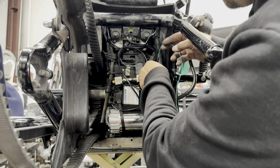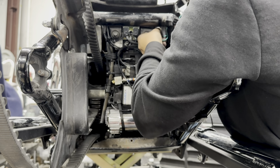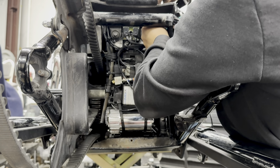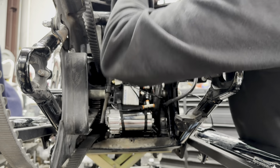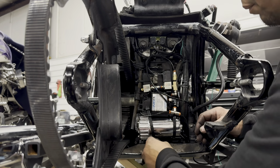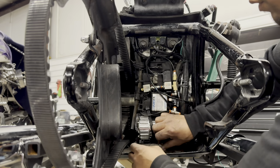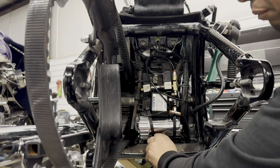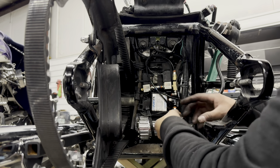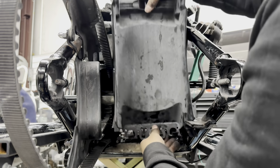Now this wire we're gonna feed upright by where the taillights connect to, where we're definitely gonna find a good ignition to use. Okay, so what I did on here is I'm using a little bit longer 1/4 20 bolt, so that way, whenever it comes time to put this plate on, I have a little bit more room to do it. You should have a clean, solid install before mounting your plate. Now we can go ahead and remount our plate right here.